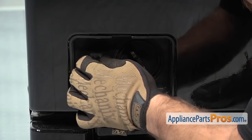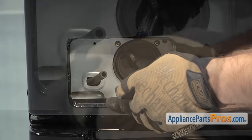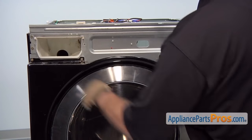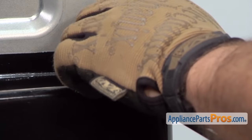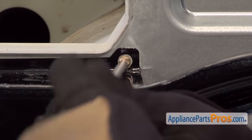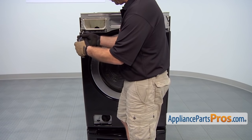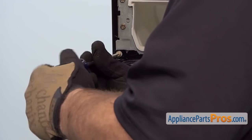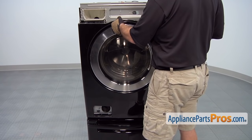We can use our Phillips screwdriver to remove the screw that holds the trim on this panel. This little inner panel should just pull right off. Once you have this little trim piece out, it will give us access to this lower Phillips screw that we have to take out. Now we can remove the four screws that go across the top and hold the panel on. When you're taking the last screw out, make sure you hold the panel onto the washer — there's nothing else really holding it on and it may fall off. Now that you have all the screws off, we can lift the front panel off the washer.